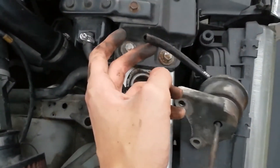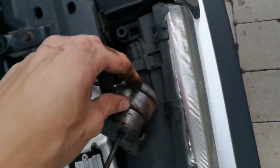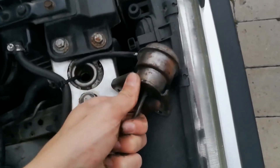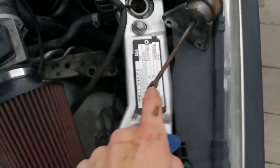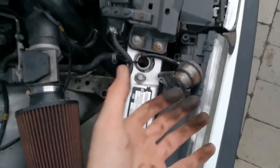This nipple here is hooked up to a hose, and when air comes out of there it goes into a small piston inside. That air comes in, pushes the piston down, and pulls out this rod — you can see that happening. Since that rod is linked to the arm down there, it opens up the wastegate valve.